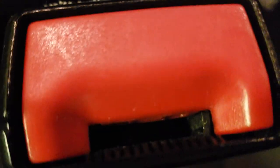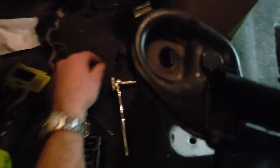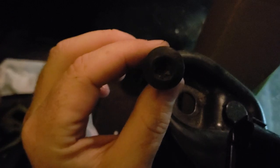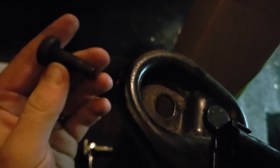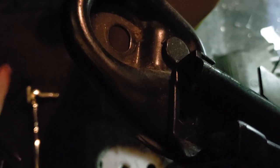I'm doing a seat belt buckle replacement because the inside of this one decided to implode. I've got pretty much the whole seat tilted back. There are four bolts right here and they're T50 torx bolts — about that long. There are four of them, and they go back in the box to hold the seat up.